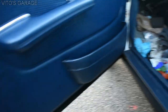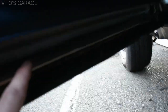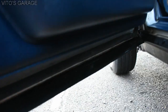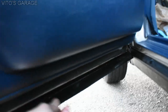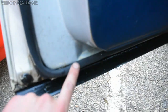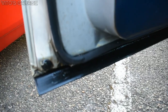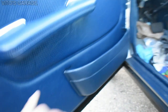I had to unbolt and remove the doorstop to clean and lubricate it. I also pulled the door seal out and checked for rust - there was just a tiny bit. I scraped the rust off, applied rust dissolver down to bare metal, then applied primer with a sponge, let it dry, then painted it. Before reattaching the seal I covered everything in fluid film - this thing is so well preserved now.